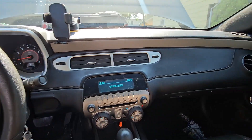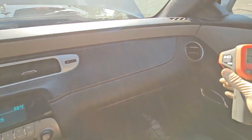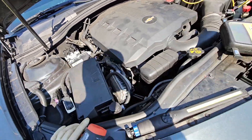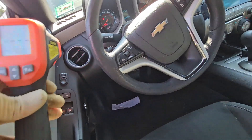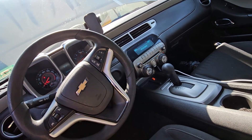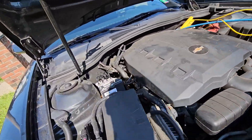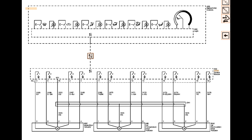With all the ports closed except for the one set to front-facing air at the lowest speed, we can see we're at a more reasonable temperature — still pretty high, but a lot better. So less airflow means more cooling. We got the heater hoses that go to the core clamped off, and now going inside we can see it's a lot colder. Not as cold as we want it to be, but we're set to fully cold and cooling flow is still being directed through the heater hoses. So why did clamping the heater hoses make the cab colder?